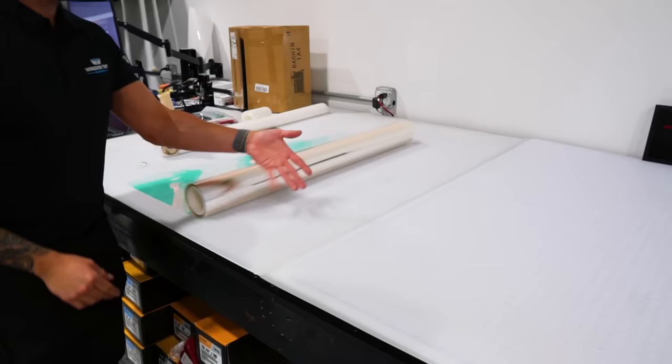Tint Whiz, venti. Reverse rolled, windshield is prepped. Just wipe the rest of the outside. What do we do now? Spray, squeegee, spray. All day. Reverse roll, get about a foot and a half off roughly. Line it up. Don't crease it. Here.